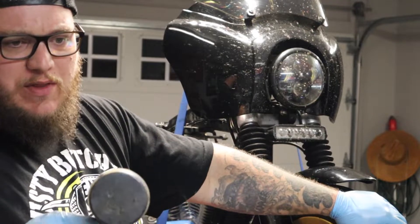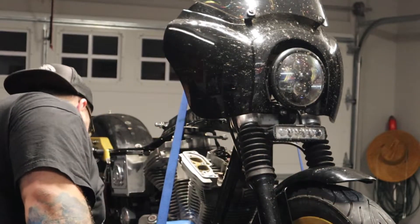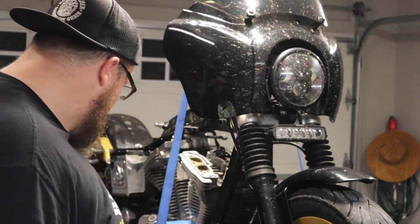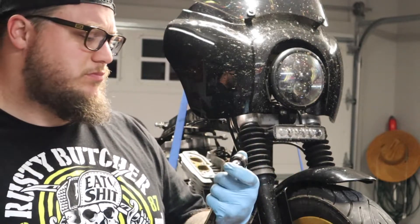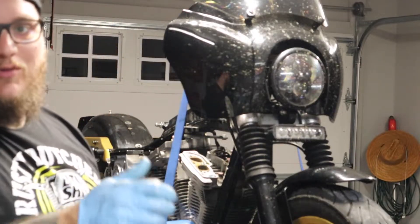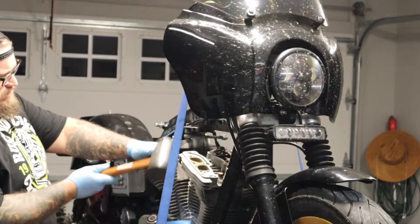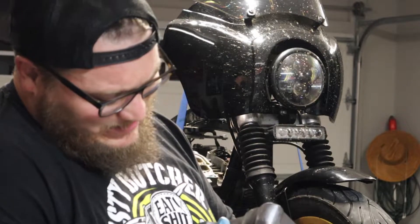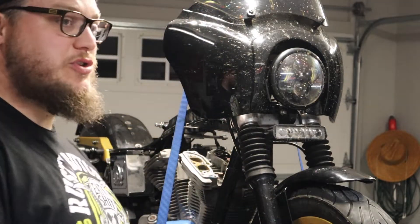That one was a little bit harder because the way the frame slopes down toward the rear, there's less clearance. I ended up using a T-handle 3/16 for a couple of them, but for the most part just a ratchet and a 7/16 — a normal regular socket will do. Once you get enough space, a ratcheting wrench gets them off quickly. Just going to whack it with the hammer to get it out. Same gasket — just tear it off and trash it.